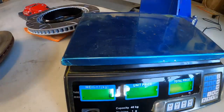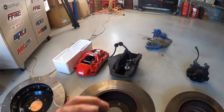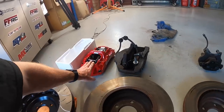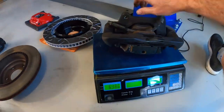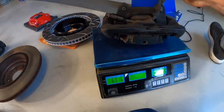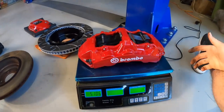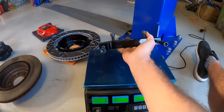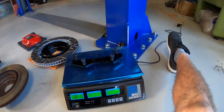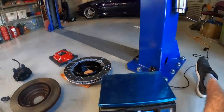So it's pretty safe to say that when you account for all of the extra hardware that has to go with this brake kit, there's actually quite a big difference. I was reading online that a few people thought the Brembos were lighter, but they were just comparing caliper to caliper. If we compare just caliper without mounting hardware, the standard one is 6.3 and the Ali one is 5.1 - so 1.2 kilos difference. But yeah, a bracket and the bolts is nearly a kilo. You do add a kilo just for that.